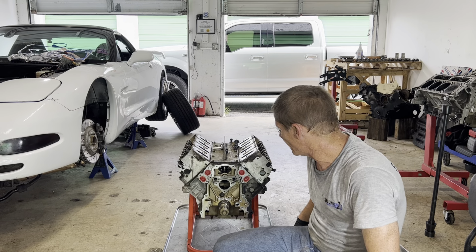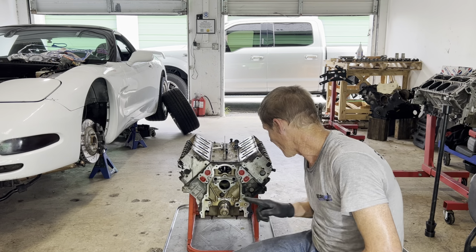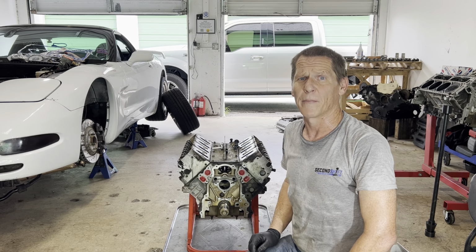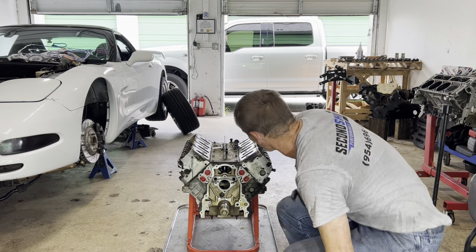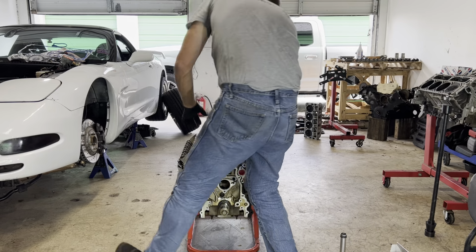And the way they mill the block when they make it, they just line bore this all the way through the block, right out the other side. And then they put a little plastic spacer in it, they call a barbell, that's to block the passage on the back and force the oil to go up to another bore to come up to the top of the bore. Some people believe that these fail.